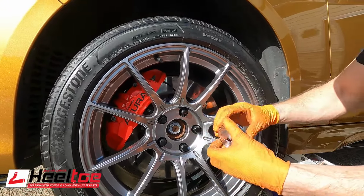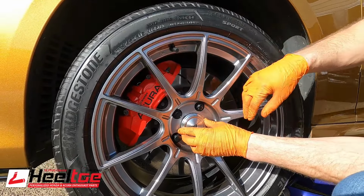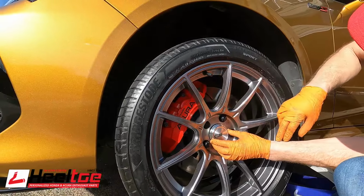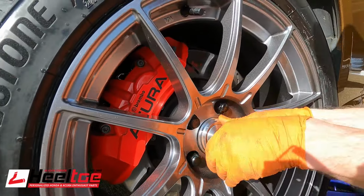When you're putting these caps in, I think that a real enthusiast is going to pay attention to the orientation of the cap. Traditionally, Honda will always have the bottom facing the valve stem. So I'm going to go ahead and install it that way, which is going to be more or less lined up like this. These just push in with an O-ring interference fit.